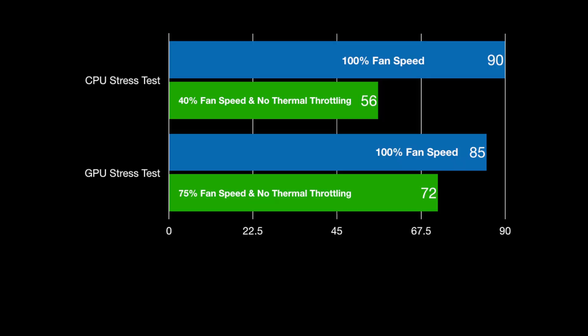The last thing I did was run benchmarks to see how well the liquid metal improved performance and temperatures for the CPU and GPU. Three things really stood out. First, it dramatically lowered the fan speed — before installing liquid metal the CPU fans would go to full speed just by starting up the laptop and opening a browser. During a Heaven benchmark the GPU would reach upper 80s to low 90s with fans at full speed. After liquid metal, running the CPU-Z benchmark with all four cores at 100% load, fan speed only stayed at 40% and the CPU temp averaged 56°C. Before it was in the 90s with fans at 100% — that's almost a 50% reduction in both fan speed and CPU temp.